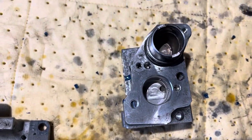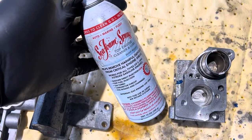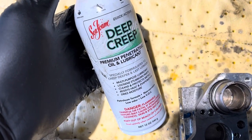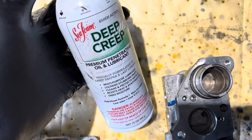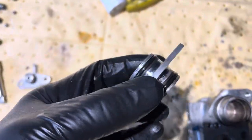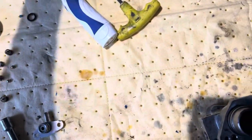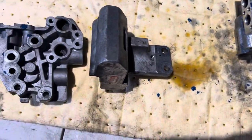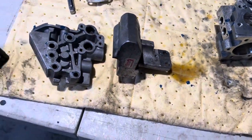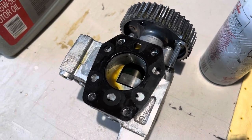You need to use non-ethanol fuel and make sure you use some Sea Foam. These are the products I'm using to clean it. Sea Foam cleaner — this is the product I use to loosen up everything. Your O-rings are going to be tight when you try to squeeze them out or pull them out — spray this on there, it loosens them up so you're able to twist the O-rings and things like that out. You want to use some carb cleaner too. Just go ahead and take your time — it's going to take you about two hours to do it. It's well worth it — get that pump out of your boat motor, your 200.